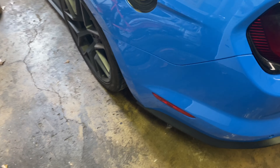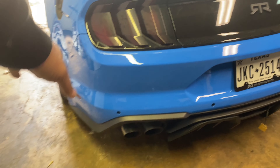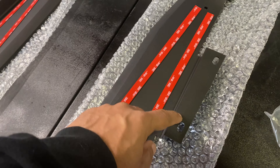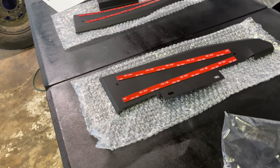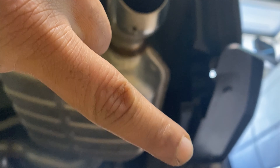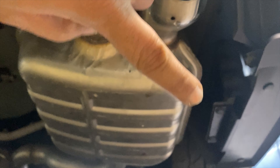The final thing for this week's install is the rear quarter splitters, going right down along here. All you have to do is clean the underside of that section with alcohol, apply adhesive promoter, stick the splitter in place, put your stock push pins in, and drill out two holes per side with a quarter-inch drill bit to install the new RTR hardware for extra security. The stock clips are there plus the two additional drilled holes — those are added security and the original ones are stock.